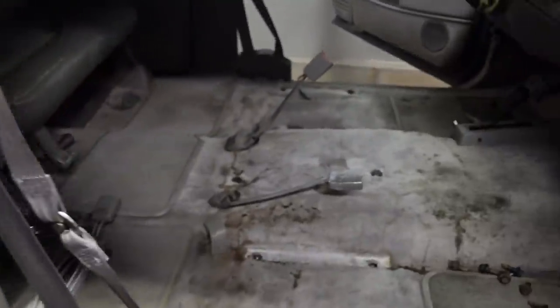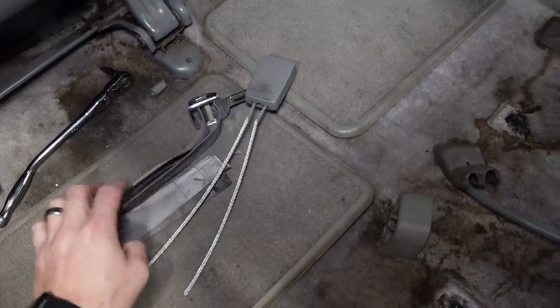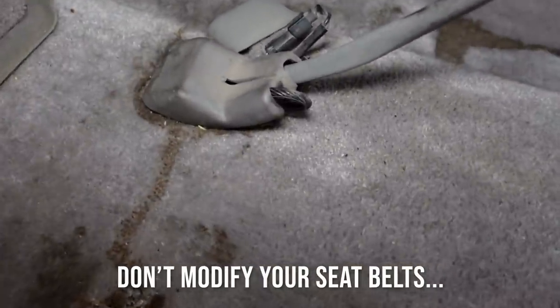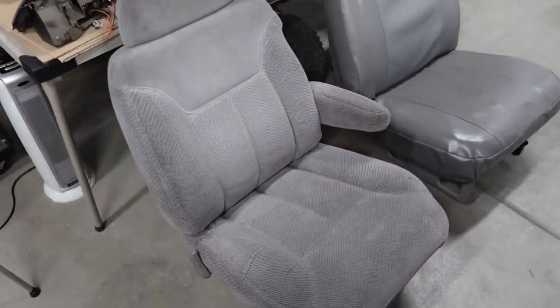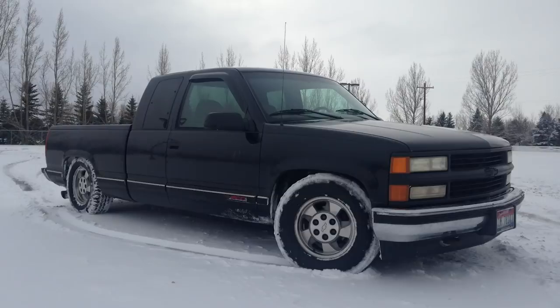I've got the old seats out and the carpet is vacuumed up, and so far this job has been super easy because everything just basically unbolts. Now if you are going from a bench or a split bench to bucket seats, you only need two seat belts, so you've got to figure out something to do with the old center seat belt. I definitely would not tell you just to cut it off right where the cable meets the base and then slice through the seat belt where it loops through on the driver's side - but you could probably figure out what you want to do there. Now as far as bolting in the passenger side seat, it is a direct bolt-in because the old seat and the new seat are basically the same exact thing minus the little flip-down armrest. One thing to keep in mind if you're going to use a Suburban or Tahoe seat in an extended cab Chevy truck - that's actually what I did on my last extended cab, the black 96 - I used Suburban seats in it.